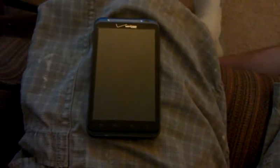This is a video on how to install a gingerbread ROM for your Thunderbolt. This is an HTC Thunderbolt from Verizon. Basically, the steps are you need to find the ROM that you want — search the forums. I'll include a link in my description where to find some good ones. Download that to your computer. And then you need to download a new gingerbread radio so that you can have service. There are quite a few radios out there and some of them are unstable. I'll include one in the description that I'm using on my Thunderbolt that works well, and I'll include the download link in the description.